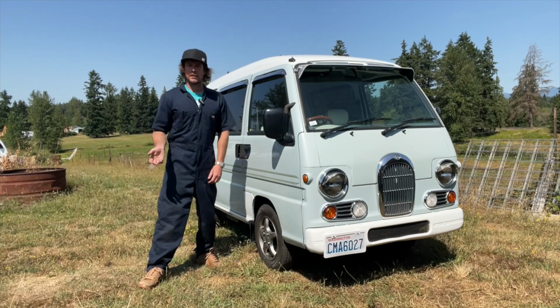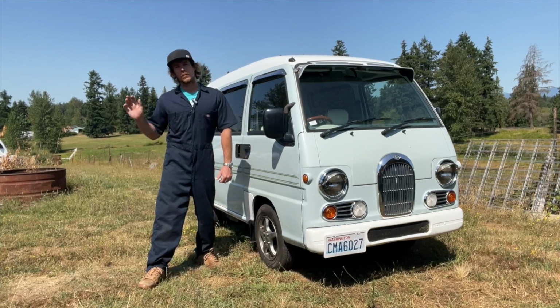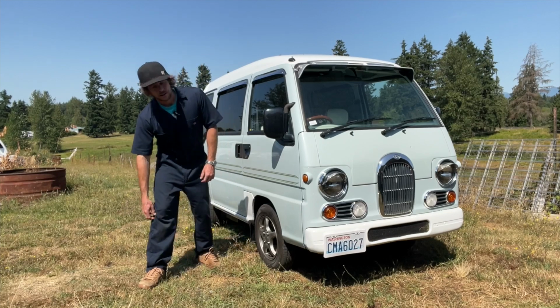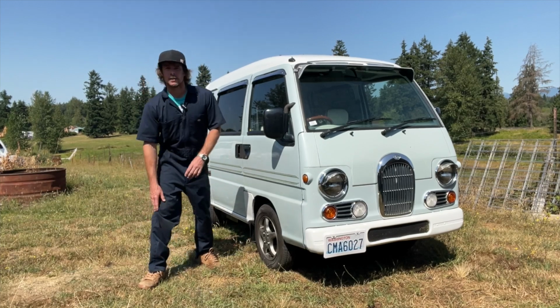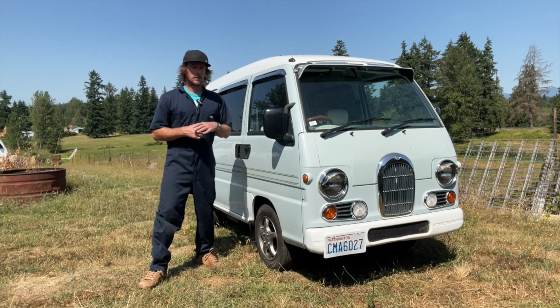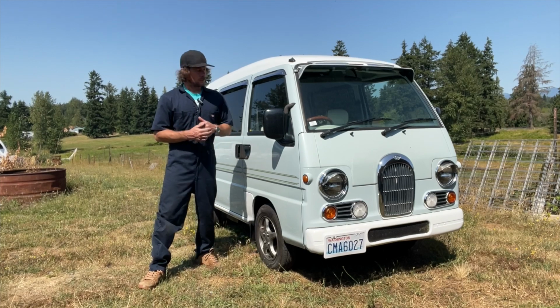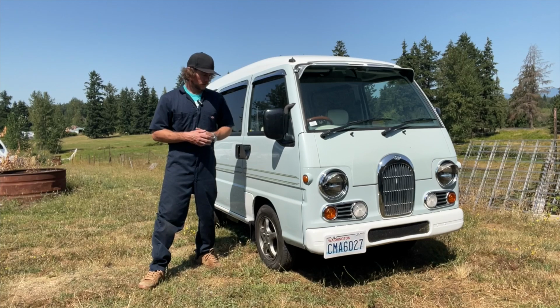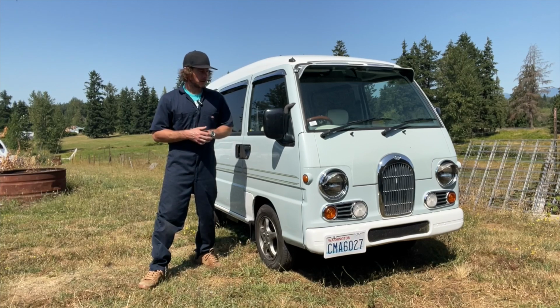And then along with that, did a thermostat timing kit, flushed the coolant because it was pretty rusty looking. And now we are clean green, so everything's happy. We're not overheating. And yeah, that allowed me to move on to some other fun stuff, which we did a special case exhaust. So I'll do a little sound showing of that so you can hear it.